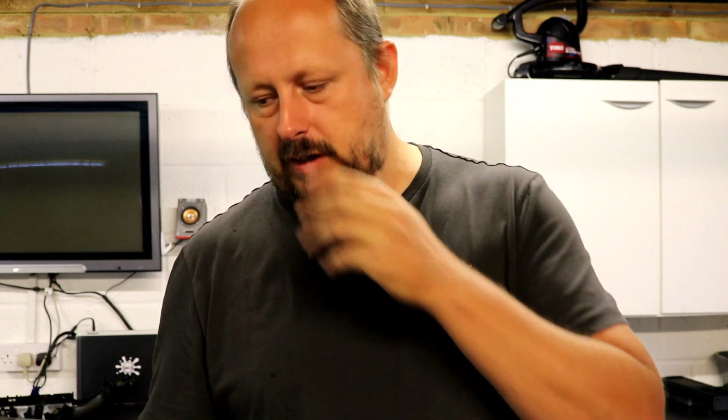So really any tire that's older than 4 or 5 years, if it's showing little signs of cracking or starting to perish around the edges, even if there's plenty of tread on there, on a high performance car, you do not want to be tearing it around with perished tires that are old. It's just not worth it. You want fresh rubber on there. So I'm pretty sure I'm probably going to end up putting new tires on there as well, unfortunately.